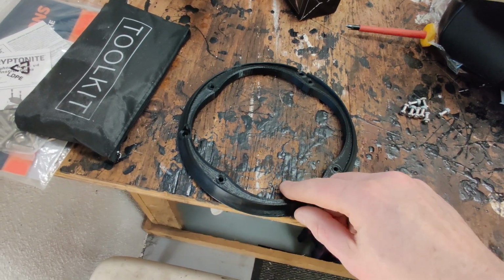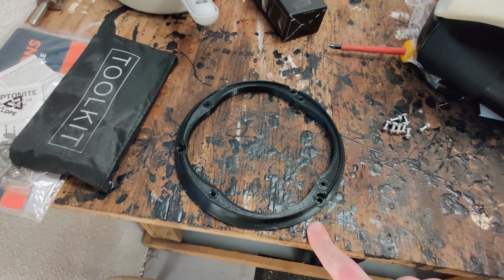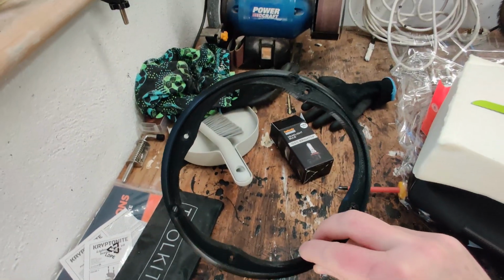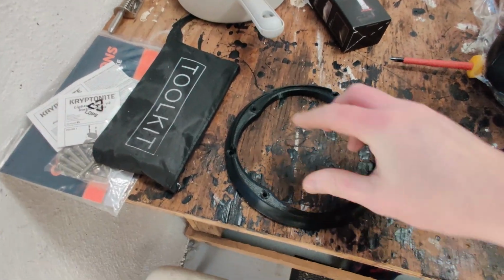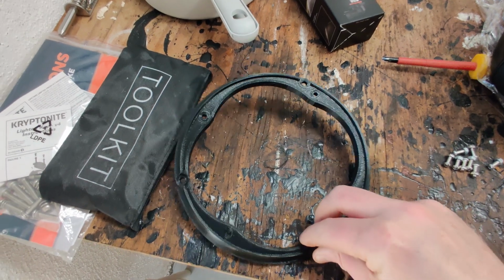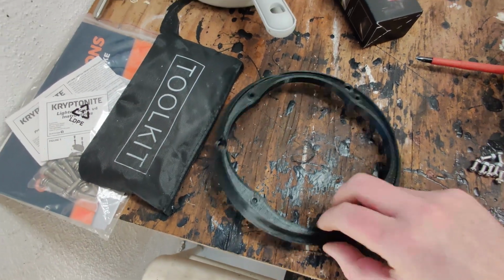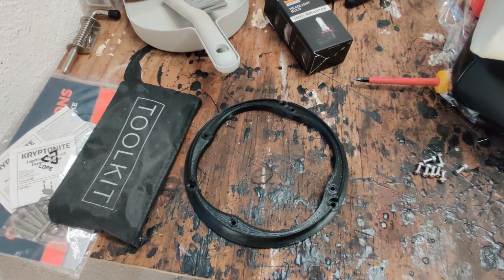And here is the adapter ring, which I've just 3D printed. This file is available on Thingiverse. It was created by one of the Beat owners, so thanks again for that. I'll put a link down in the description for this if you want. This basically just makes it easier to install. It's a step I didn't bother doing last time. But it changes the speakers, which have a 4-screw layout, to the Beat's 3-screw layout, which is kind of a weird PCD. So, pretty sturdy unit, should make it a lot easier.